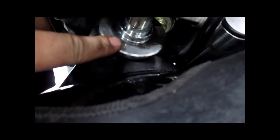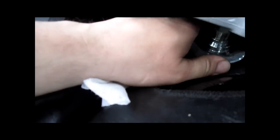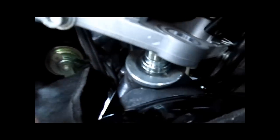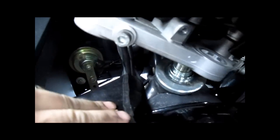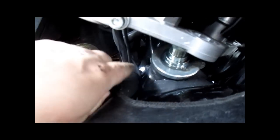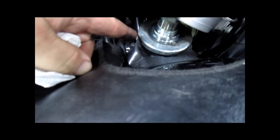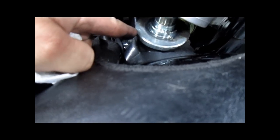Now you have, see that big collar here? This is what actually adjusts the tension on the steering head bearings. BMW used to have this goofy tool, a pair of pliers with a little foamy rubber on them to reach in. You have to loosen all of this when you do a head bearing adjustment, but you had a tool to get in there and adjust them. Unless you're overly anal, you probably don't care about having little marks in these. They're knurled anyway. I generally use a chisel to catch the corner and tap it.